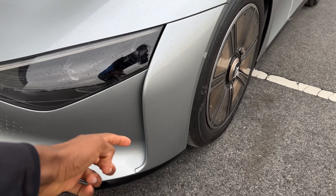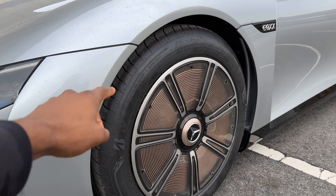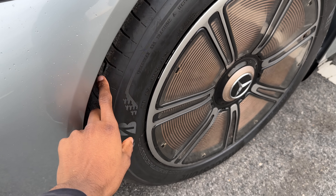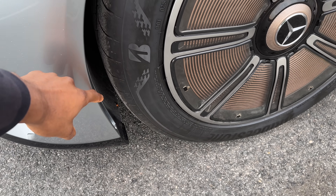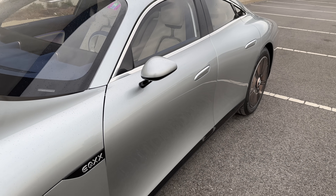You've got these side curtains where air slips through, and a huge reason a lot of electric cars have less attractive wheels is because they're trying to be aerodynamically efficient. This design is just about as aerodynamically efficient as you can have a wheel. They have specially designed tires with a rounder front area and lower rolling resistance — pretty narrow. When air gets through this channel, it smoothly goes over the side of the tire and bends around the car with no disturbance. This is more of a demonstration of what happens when you combine all possible optimizations into one car — certain production cars today will balance some of these things while making sacrifices on others.